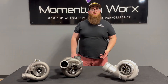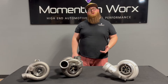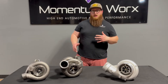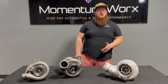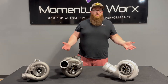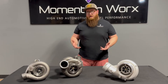For a guy who's an owner-operator and really wants to work on his own truck, the single turbo makes a lot more sense because it's just cheaper and easier to maintain — there's much more space to work on that side of the motor. What we have here is an S410SX, the Momentum Works Zeki, manufactured by Zeki and branded as Momentum Works Turbo. This one's a little pricier because it has a billet wheel and a 360-degree thrust bearing. But if you just needed a generic single turbo for a Caterpillar motor, you could pick something up for probably a thousand bucks if you were broken down on the side of the road.